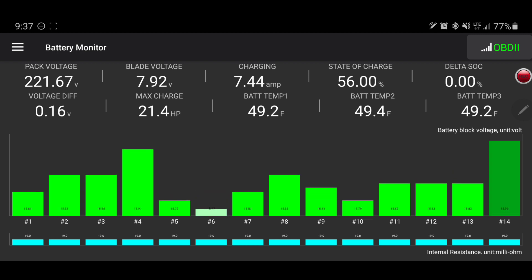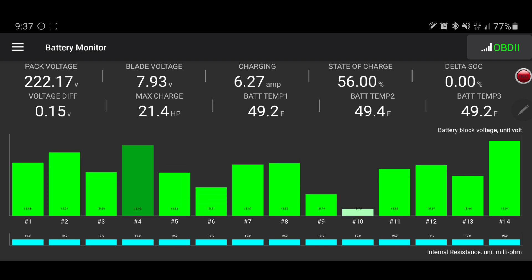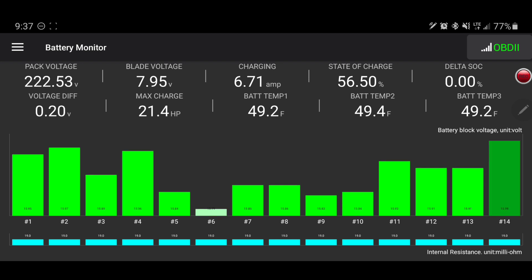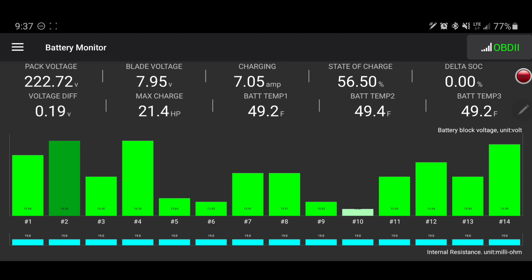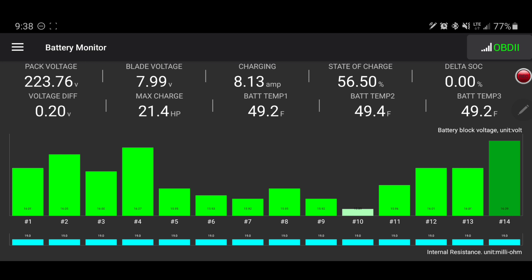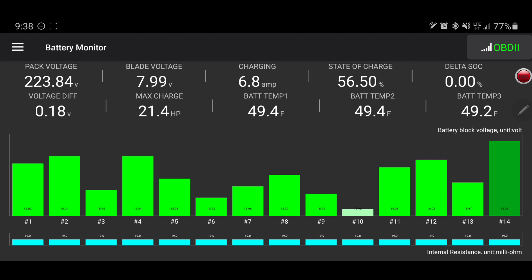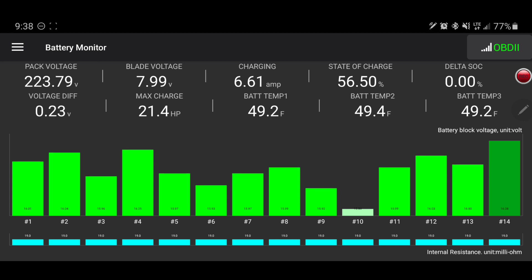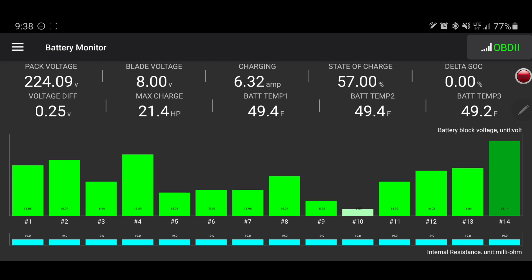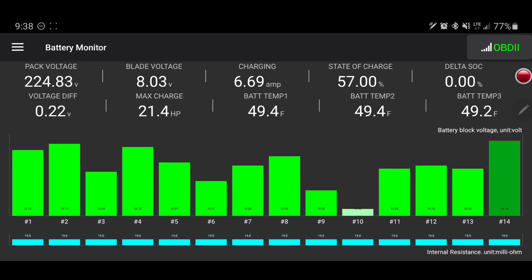The highest acceptable limit would be 1.2 volts — that's kind of when you get to start throwing those warnings. And if you remember my teardown videos, we covered that 1.2 volts is exactly the voltage of one cell within a module, so that would make sense. So if we're at 0.19, that's pretty balanced, and this is going to fluctuate depending on load. Right now we're currently charging at about 7 amps. I have the heat on because it's about 30 degrees outside. This looks like it's within the acceptable range, so we'll go ahead and continue driving.